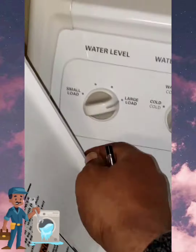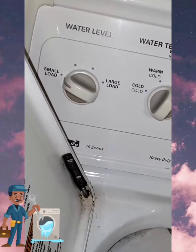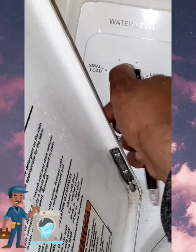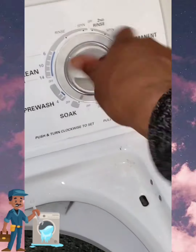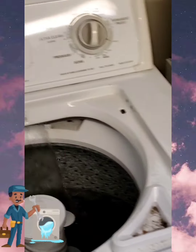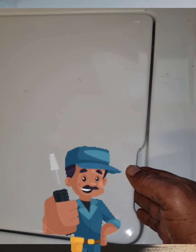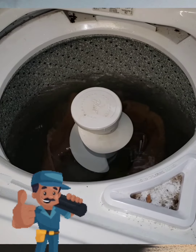Re-verify neutral drain on every level. Large was verified, medium was verified, small was verified, large just verified. Now medium. Once 80% of the water is drained, the basket will then release and will then begin to spin.